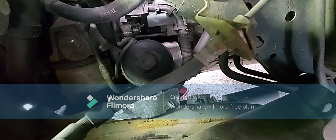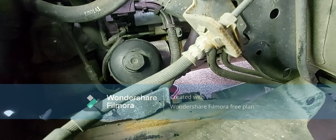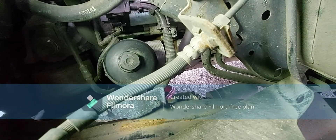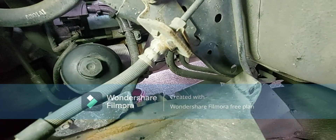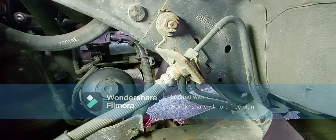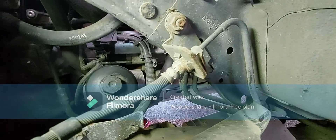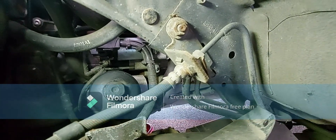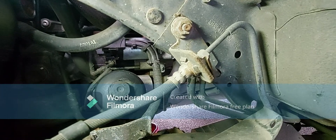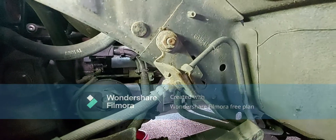And there is the filter. That's where the filter housing is. So this is accessed from the passenger side wheel — you need a 27 socket with a long extension and a ratchet to remove that. I'll go ahead and take it off and then show you when it's out.